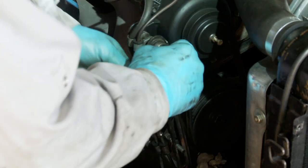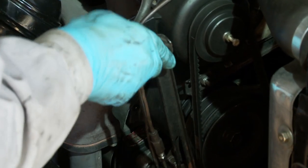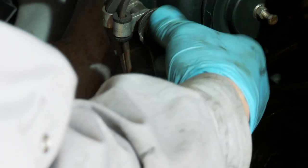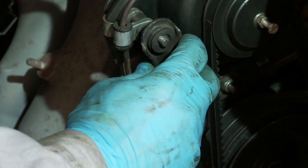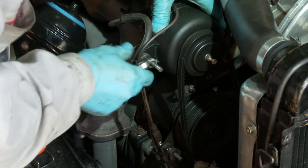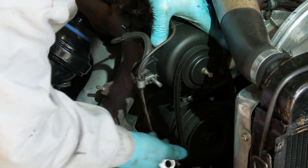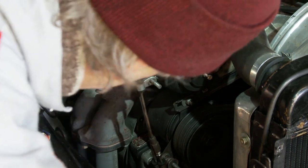Provided the fixings are doing the job it's fine, though there should be a washer here going into a rubber bush — the nut isn't able to do its job properly without it. That's not a fault of the owner, just the way it is. Slackening the belt by forcing the tensioner down on the pivot — and there's the drive belt removed.